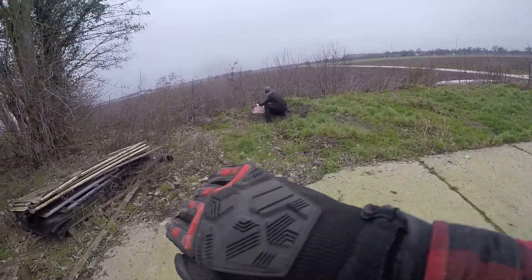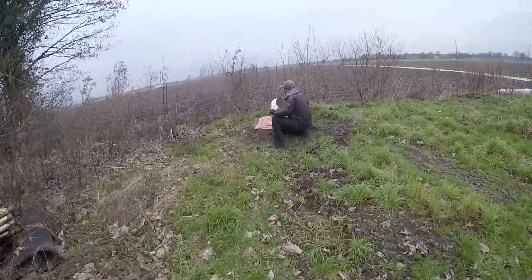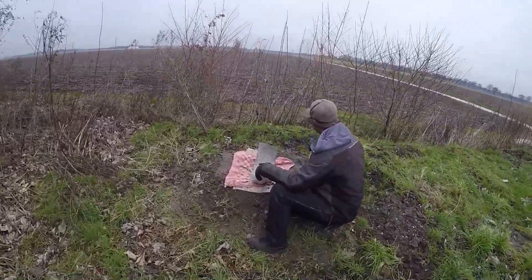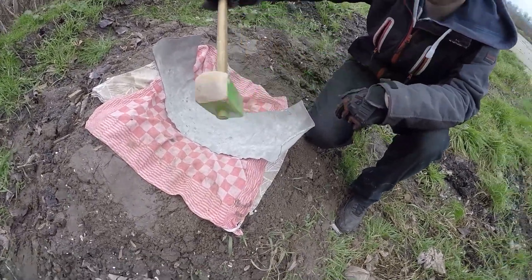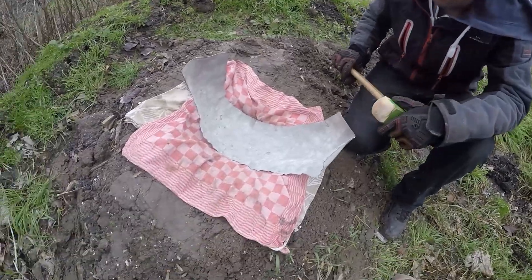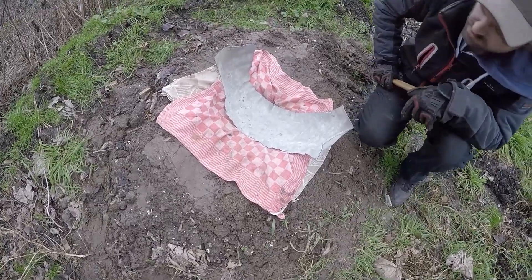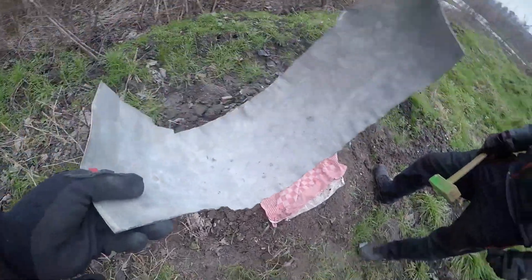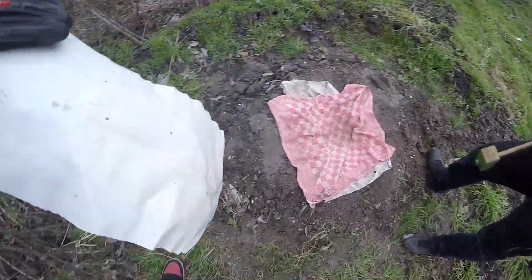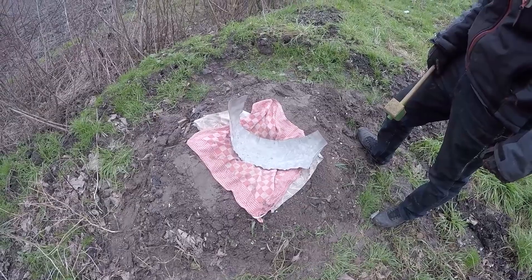So the wheel arch is basically curved in two directions and metal doesn't want to do that. We came up with the idea - since we don't have an English wheel or the right tools - to make a rounded hammer and use a hole in the sand, and we start bashing this piece of metal to make it into a wheel well shape. As you can see it's not quite there yet but it's taking both shapes. You're never gonna see it anyway, so it doesn't have to look the prettiest - it just needs to fit and do the job. So we keep bashing.